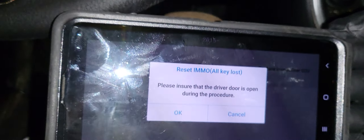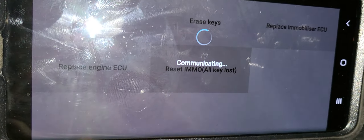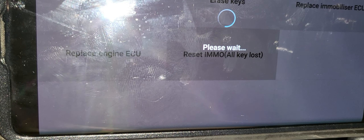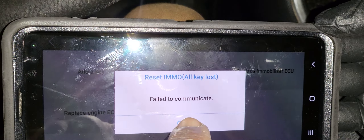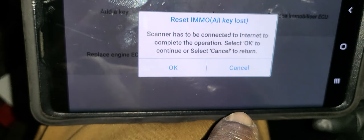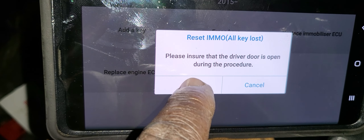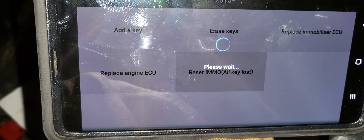I'm looking for the X tool. You have to have internet - most of the time if you are outside of the internet zone it will not work. I'll go to immobilizer and try to communicate. I'm going to immobilizer, then to a place called H4, 2015 and up - click on it.